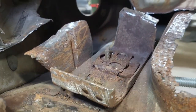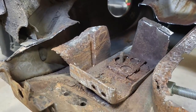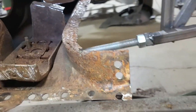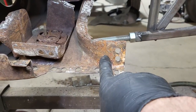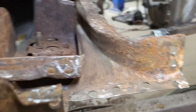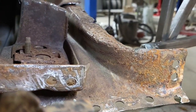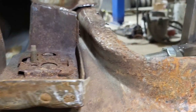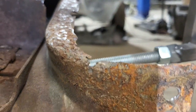There is some pitting that I have to fix. We're going to have to treat and coat all of this. If you look in here, you also see that the bottom — this would be the bottom side of the A-pillar that you cannot see — this is where it meets up against the rocker. And if you glance down there, if I can get the camera in here, you can see that this is all pitted all the way up. You can even see holes in here.